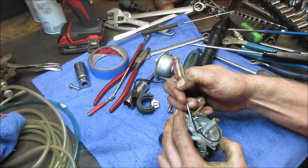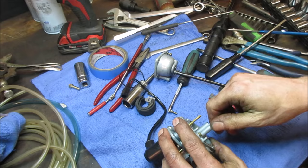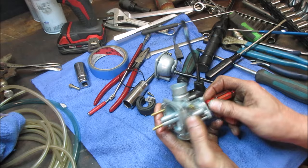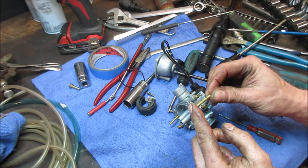Let's get that gasket out of there real quick. Let's try pushing that Venturi down. See if we can get that to pop right out of there. And we have a bad O-ring or something around it. There we go. I should have cleaned the first time around, which I did not. I'm gonna look real quick and make sure those pores are open. I do see some crap